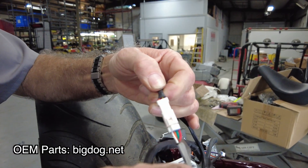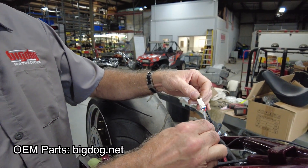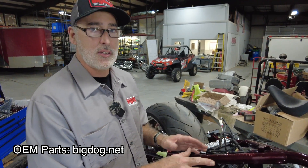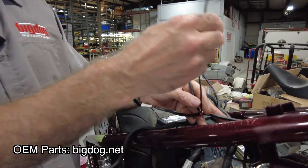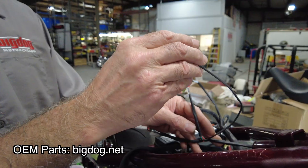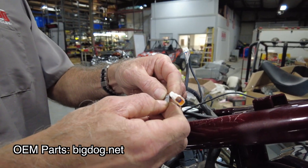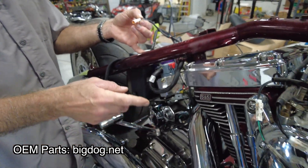Now, the wire colors are not going to match — and that's okay. These have the correct voltage going to the correct sensors and electronics; everything's all set up. So you don't have to change anything but plug in those two four-pin connectors. We're not going to use the ground because the system has already grounded itself. That leaves the next four-pin connector here.